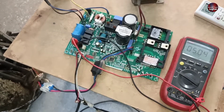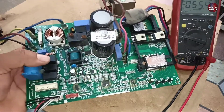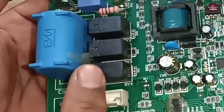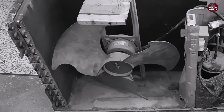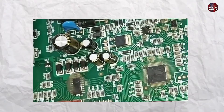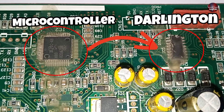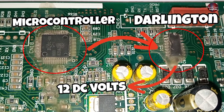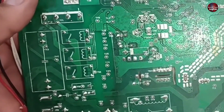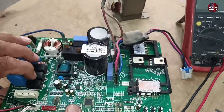Let's check what the fault is in the PCB board. When the fan does not work, the PCB control board could have 2 to 3 possible faults. These relays are installed here, and if the coils of these relays go bad internally, or if the contact points get stuck, the fan will not work. But all of them getting stuck at once is impossible, so the chances are on the PCB's low side. If the relay does not switch on from the low side, the microcontroller passes signals toward the Darlington array. Based on these signals, the Darlington switches on 12 DC volts to energize the magnetic relay. The first step is to check whether these relays receive 12 DC volts from the Darlington. If they receive voltage, the relays have gone bad. If not, I will further check the low-side voltages of the PCB board.